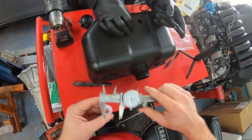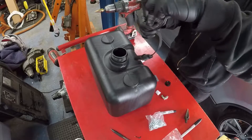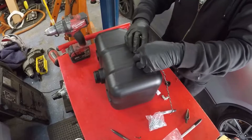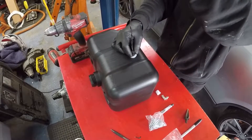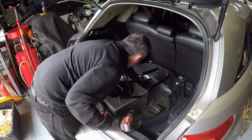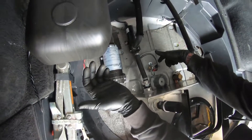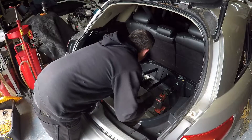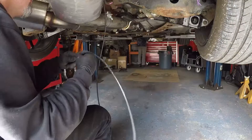Now stepping back in time to see the work Jay was doing on the methanol reservoir while Ron and I were under the hood. First, Jay is getting the low fluid level sensor installed into the reservoir. This is an optional part but I highly recommend it, especially when using methanol not just as a boost cooler but as a supplemental fuel source — that way if methanol runs low you don't risk getting on throttle under boost and doing motor damage from a lean condition. Jay has been working in the hatch the whole time, and we decided to install the methanol reservoir on the driver's side of the hatch, with the injection pump mounted right onto the floor.